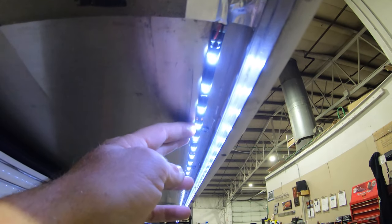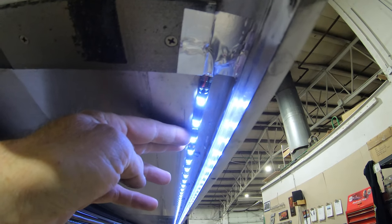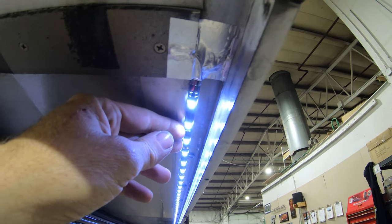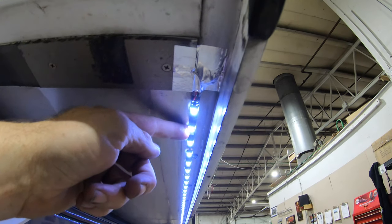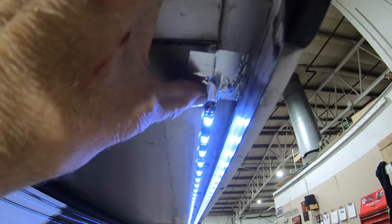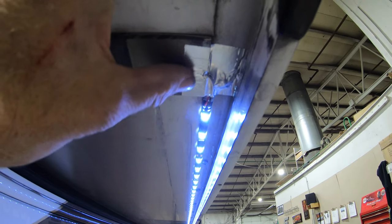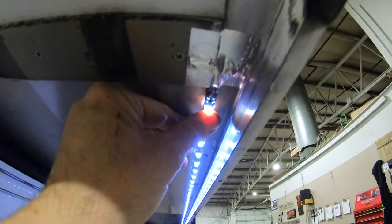I've got this end installed here already — it's set in just on the edge of those screws on that flange. I've prepped the surface with a red scotch bright and then used a Sika 205 activator to clean the surface. I've got this foil tape to seal the holes up, which you'll want to do especially if your wipe seal is going to land where your wire is running.